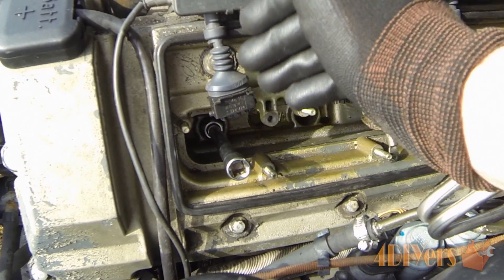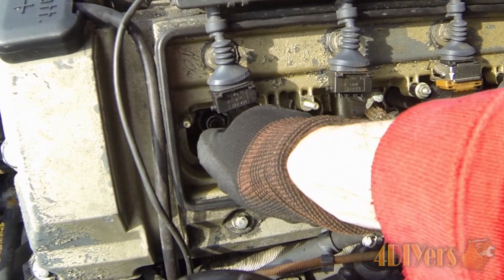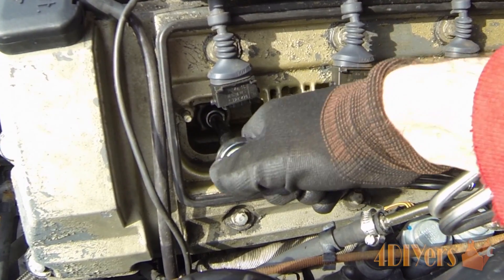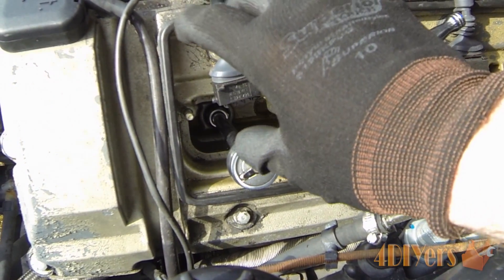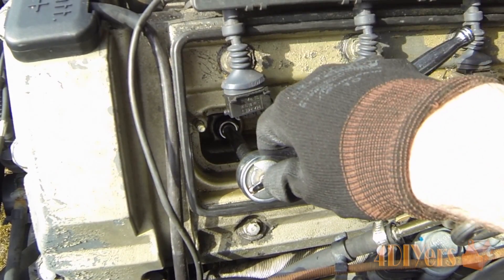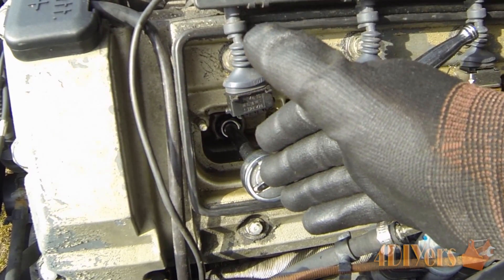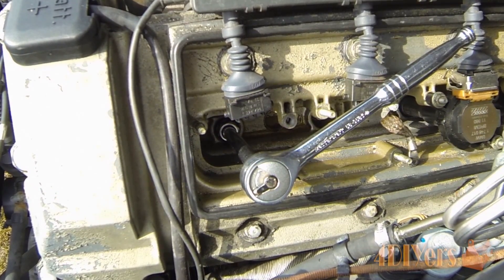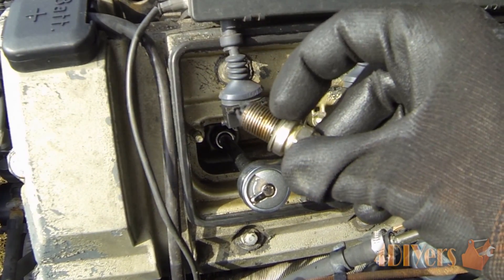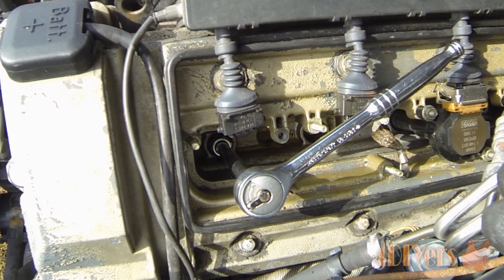Never use an impact gun whether removing or tightening spark plugs, as you risk damaging the threads in the head. Once snugged up by hand, continue going in the right direction and tighten them up. As for tightening, there are torque specifications which I will post in the description below. If you are experienced you can feel it, or you can torque them to spec. The torque specs depend on what type of spark plugs you have — one with a tapered base or one with a gasket base, like these ones here. The size of the spark plug and the type of head material also make a difference.